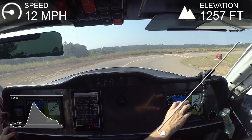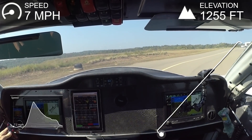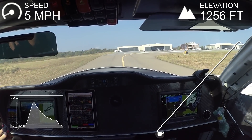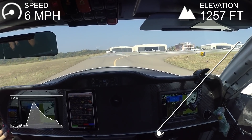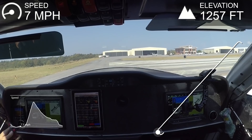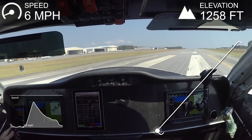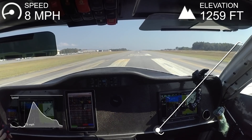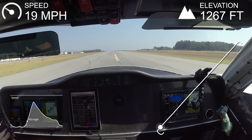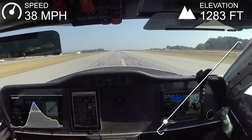Now going back — this next bit of video is that actual first run you saw with a side camera angle, and this is from inside the cabin. This is with the old tune, so the maximum fuel pressure I'm delivering is 95 megapascals. After I've gone through and tuned this up that's going to be doubled, so injection time will take about half as long. I should see much better performance — better efficiency, lower fuel burn, more power, less smoke, and lower EGT. It's going to be a win-win-win. But I have to adjust the pressure and at the same time adjust the timing, because the timing is coming in too early. As I increase the pressure I have to reduce the timing so it comes in a little bit later to even things out.